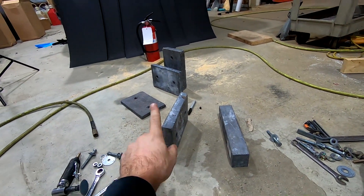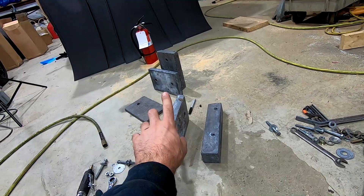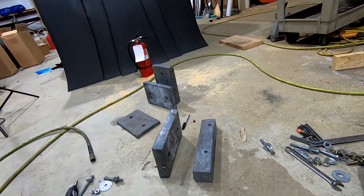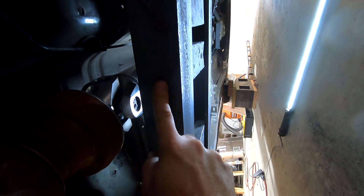I've been counting all the weight I have. The long skinny ones are 175 pounds, and I have 50 pounds of the shorter wider ones — so that's around 225 pounds. Plus the frame itself is so thick and heavy duty that's at least 20, maybe close to 30 pounds of steel. The car needs to come up about 250 pounds minimum, and all the ballast included with the frame is right around 250 pounds. But don't forget I'm adding the diffuser and the flat floor that will purposely be built out of three-quarter inch plywood, so that's going to add a bunch of weight too.